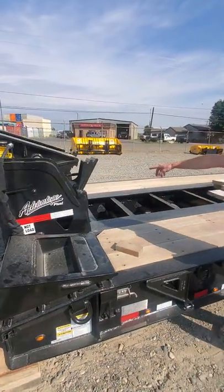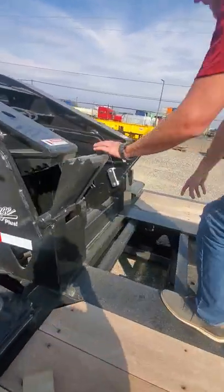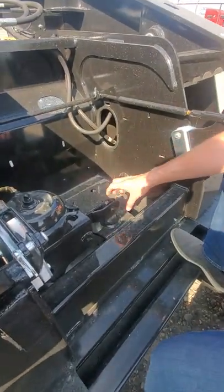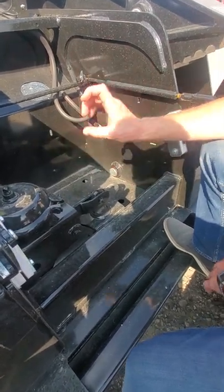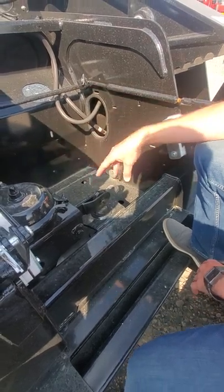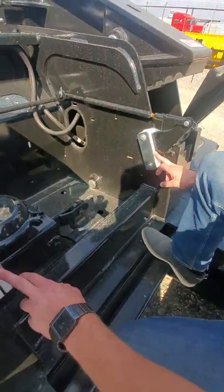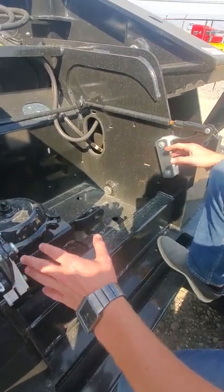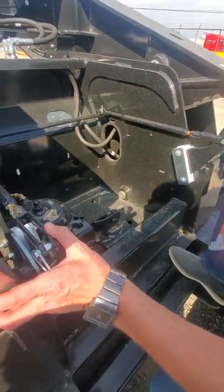One other recommendation on the lock pin: these come with grease out of the factory. In the wintertime, if you do a lot of gravel roads and things get cold, that grease can bind a little bit and make it slow moving. I would clean all the grease off and use dry graphite spray for lubrication instead. Especially in colder climates or the colder part of the season, it's going to make it easier to free flow up and down. These little white blocks here are just tension blocks to keep the doors from flopping around when you're moving them. If they're a little tight, you can loosen them — that's all their purpose is.